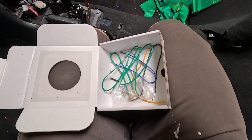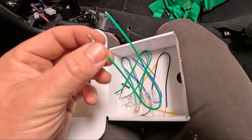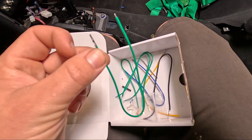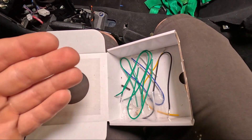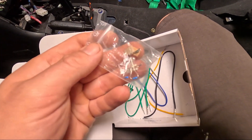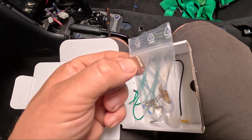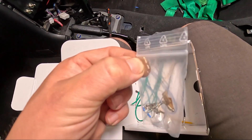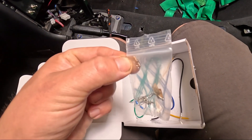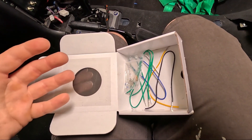If you're installing this gauge without using the CAN bus system, the kit includes a load of pre-terminated wires you can put into Plug C, so you can wire in a few sensors individually. Also included are a few pull-up resistors if needed for certain sensors, and you're supplied with a few ends to terminate your own wires to put into the plugs — just like I've done. Basically everything's included to wire this gauge up however you want.